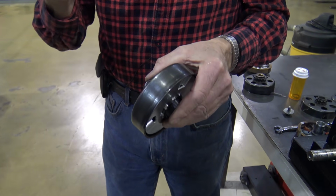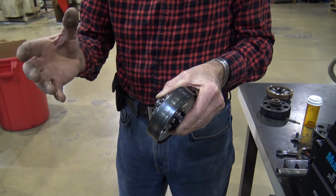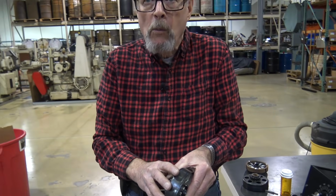The snowmobile people use this drum as their brake, just like some of the mini bike people. It's the dumbest type of brake system you can have, but the simple reason is you want to keep the clutch as cold as possible. It'll be more efficient. So having a brake band around the clutch doesn't make any sense at all. And so if the chain breaks, the only thing you're stopping is the clutch.